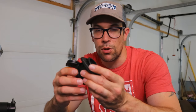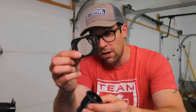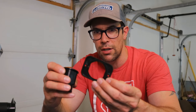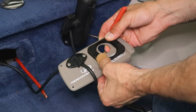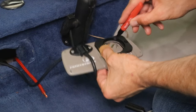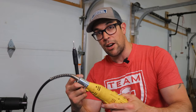For the new receptacle, we'll take it apart — unscrew the back — and this whole square piece is what we want as our template for aligning it properly. We'll line it up on the piece of plastic, draw out how it needs to go through, get a marker and mark where we need to cut. I'll probably use a Dremel to cut it out. Line this up reasonably straight, trace our template, and get the Dremel out.